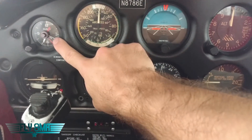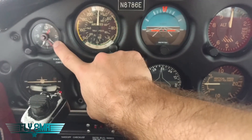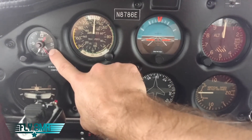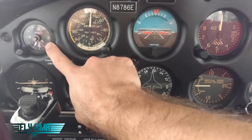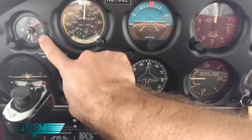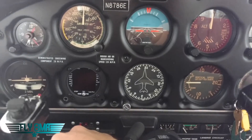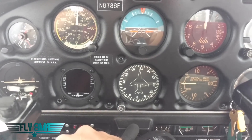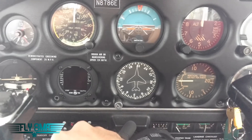So for starters, we've got our clock. Our clock runs off of 12-volt DC power, so it's just running off the battery and it's not going to run the battery down. I mean, it would take years and years for it to do that — it's using very little electricity. The battery will go bad on its own long before that happens. So it's directly connected to the battery, keeps running 24/7 even with the master switch off. It's not connected to one of the buses; it's connected directly to the battery.